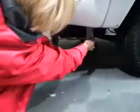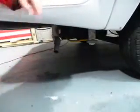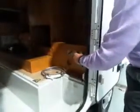You'll have a freshwater tank and a waste tank. If you turn that open, it'll empty it all out. It's the hot and cold. That's the feed. So that's your shower unit. It clips into there. That obviously comes direct from the tank, that comes from your hot water tank. So this allows you then to change. It's like a mixer tap, and that's the flow.